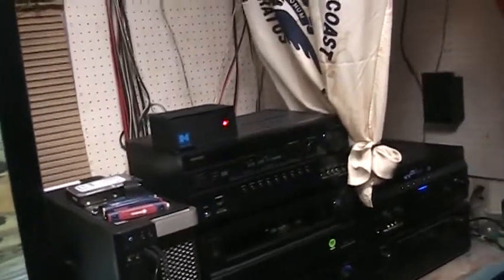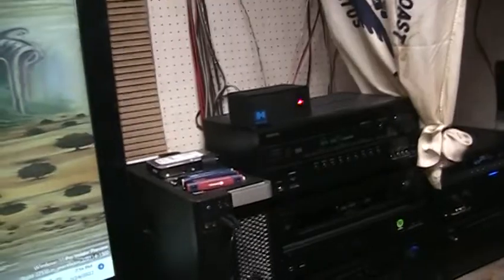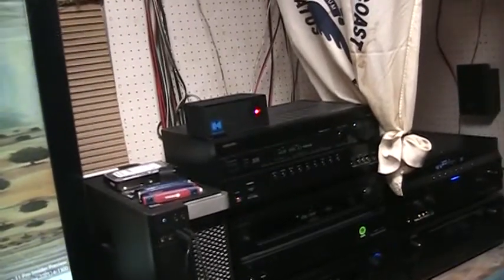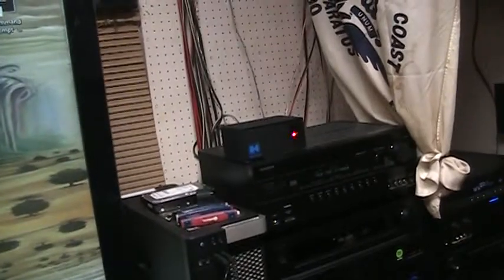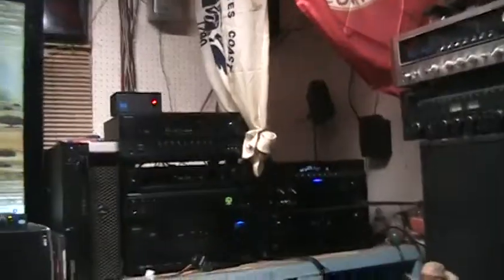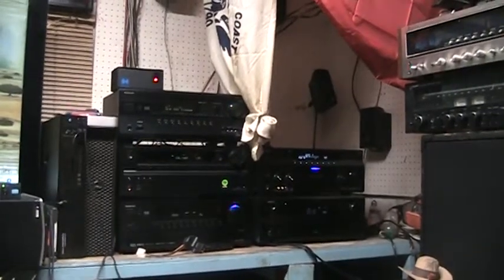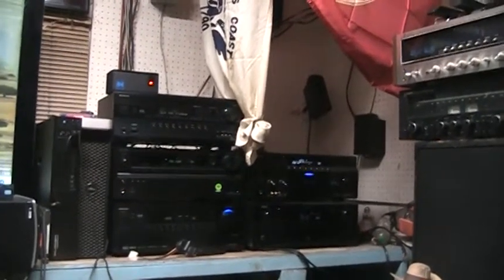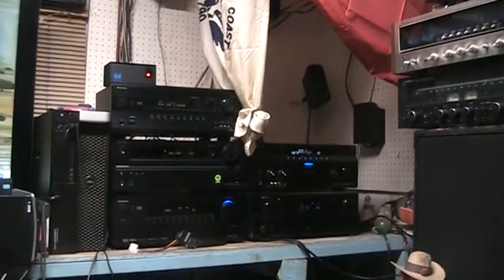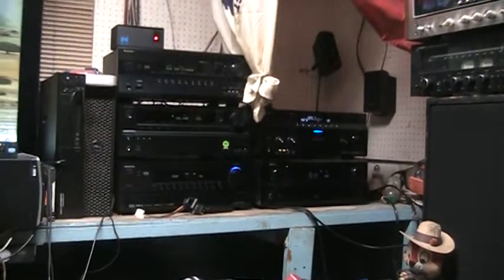How did I pull this off without a bunch of annoying echo? First off, I'm not running Dolby anything. My backbone carrier is a combination of ASIO on Windows and Pulse on Linux. The Sony over there is fed from an Asus Xonar HDAV 1.3 Deluxe — its only purpose is to convert my DTS backbone, which is how I carry my timing, back through ASIO. That card's only purpose is to keep the timing and convert to a straight multi-channel PCM signal for that Sony.